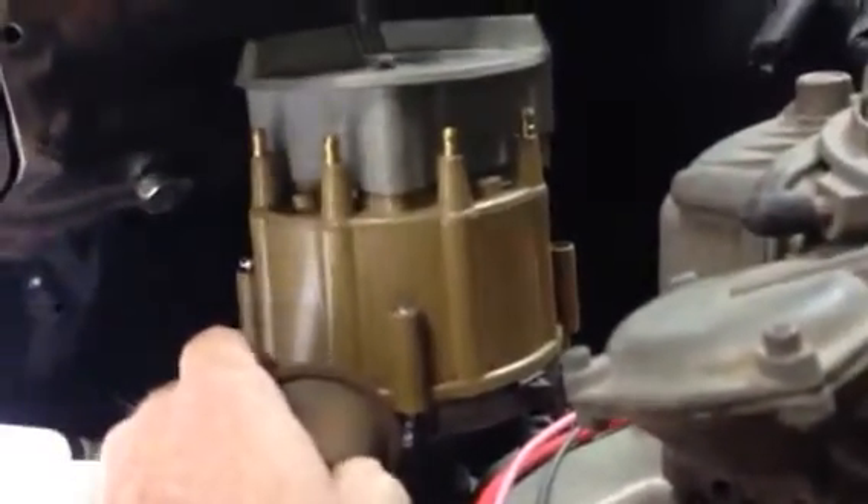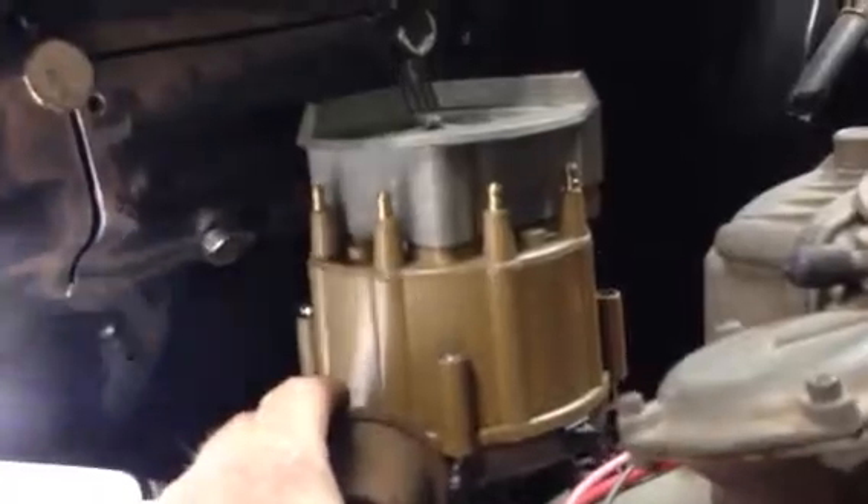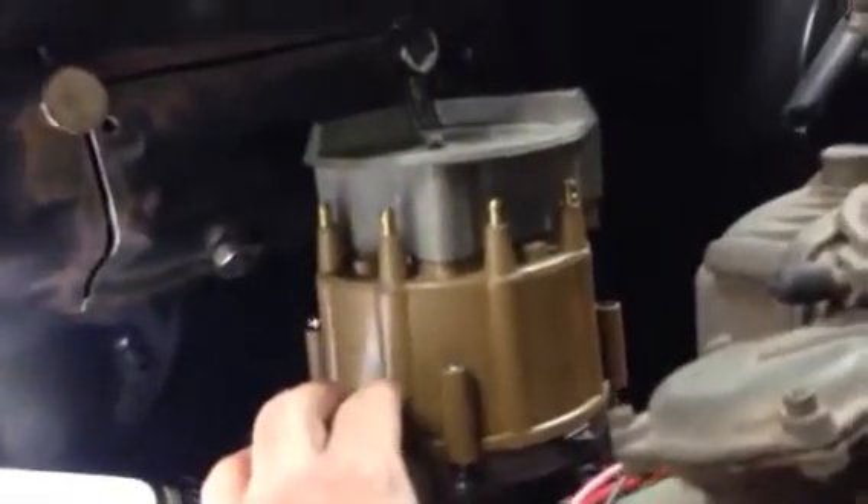It looks great sitting there — see how these two are straight across from each other. If the distributor was there and I didn't have to turn it much, I think it's gonna work. This part on the gray cap is barely touching the firewall, maybe an eighth of an inch away, so maybe I could shave a little off this plastic cover on the back and give me about a quarter inch clearance. Looks good and I'm pretty happy with where things are.